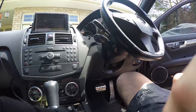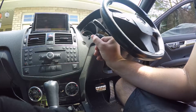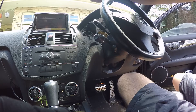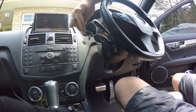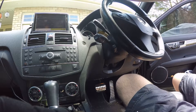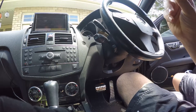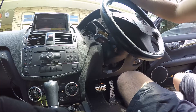With the car on and your headlights on as well, you're going to push your washer knob in. Your washer jet should be working, however in this case it's not. I believe it's on a five-time interval when you press this in — if your car has xenon headlights and washer jets in the bumper, that will shoot out and clean the headlight.